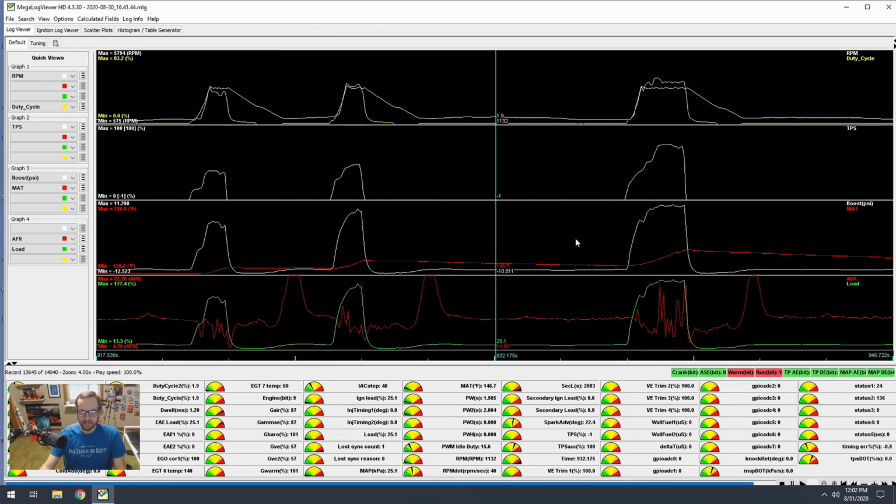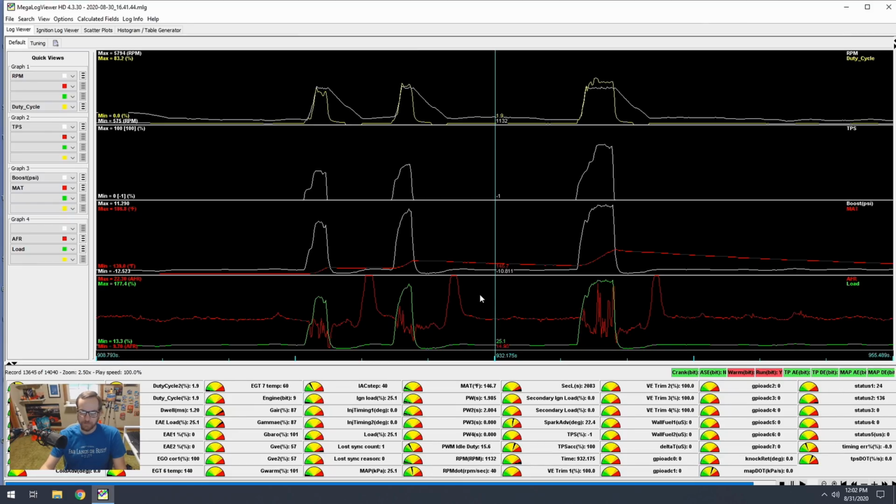I did look at the data at the end there where I did the different launch control settings, and I can notice distinct differences between doing the fuel and spark cut, which is the nice safe option, versus just doing fuel cut, which was the really unsafe option, versus doing just spark cut, which is the really fun option. The fuel and spark looks great. It holds 3,000 RPM beautifully. There's not really any creep in intake temps or anything. It's very calm. Well, I wouldn't say it's very calm. It's actually pretty violent. It actually does a pretty good shaking, and it leaves hard.